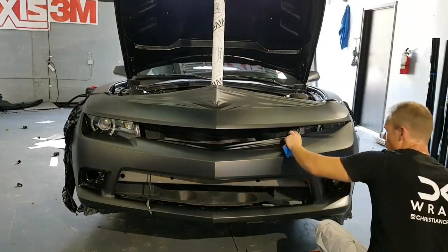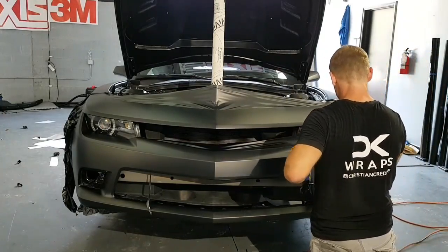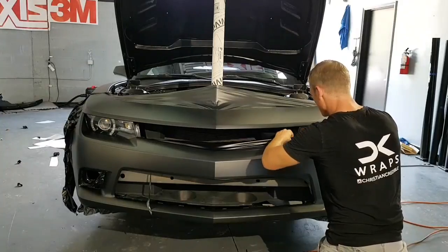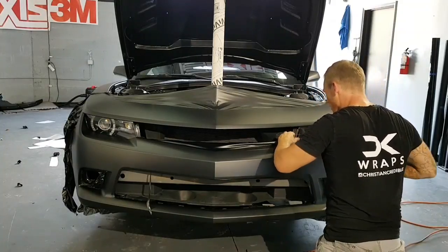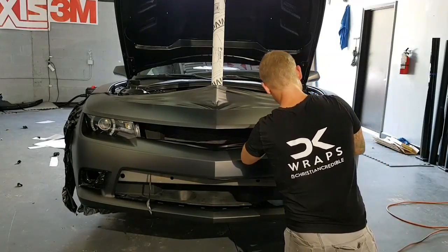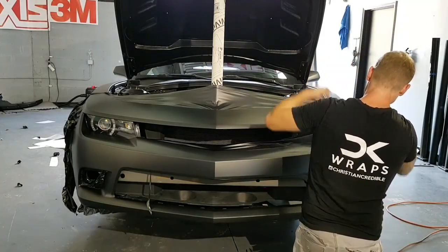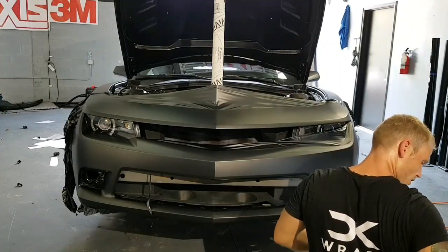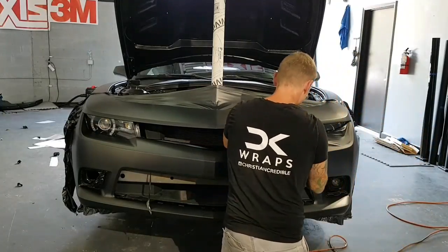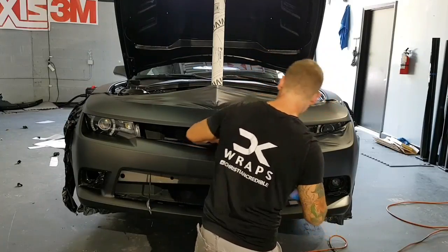And this one here. Can't use the knifeless tape because it's kind of bent out of shape, so I'm actually just going to try to get it out of there. And I'm going to freehand this one. So I'll show you when we freehand how gentle. It's really going to be hard to tell on camera, I guess, but how gentle you want to be.